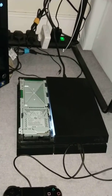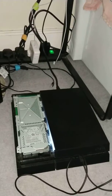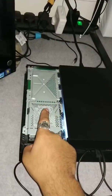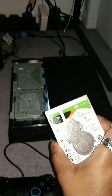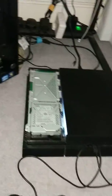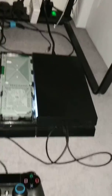I'm just here to confirm the question that has been asked regularly but I haven't found an answer to, so I've done it myself. The question is: can you put your old hard drive disc back into the PS4 once you've upgraded to a new hard drive? And the answer is yes — as long as you haven't tampered with the old hard drive, you can plug it back in and the PS4 will recognize it as its own hard drive and carry on playing with it.